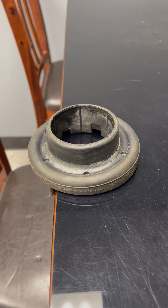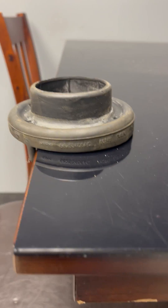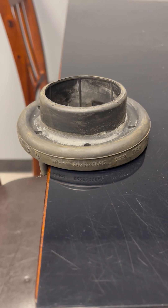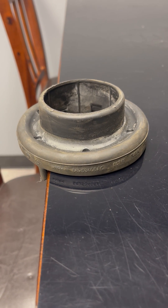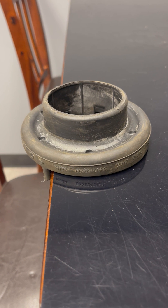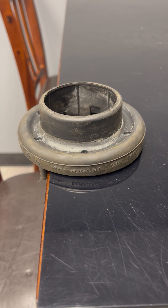Once flipped, you will no longer have springs buckling and bowing towards the inside of the frame. If you have an isolator that looks like this — completely reversed from what is conventional in Jeep applications — doing this will solve all your problems with coil springs buckling towards the inside of the frame.